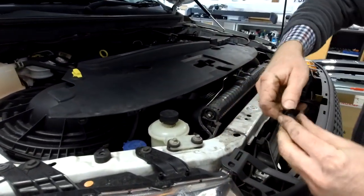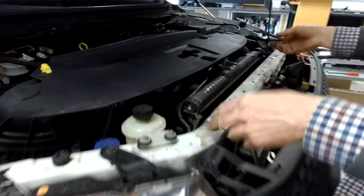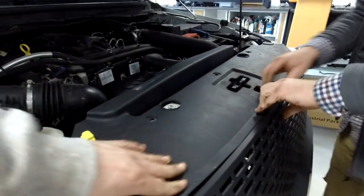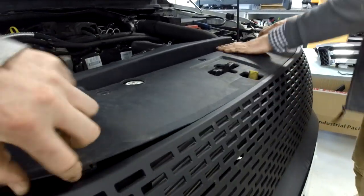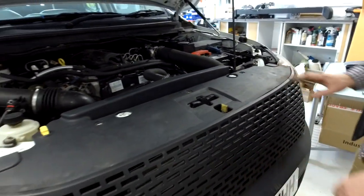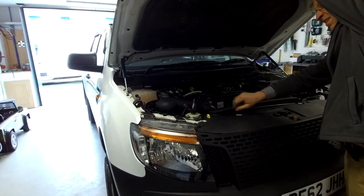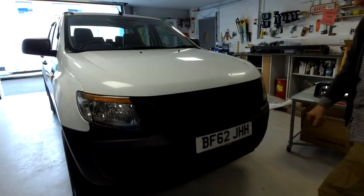Let's close the bonnet - we've just got that top tray to put back on. That top tray should hopefully just click back in. See how these line up. You've got the foot - that actually goes back not too bad. Then you've got those clips to put in - that's just the same as we've just done. Push the outer bit in first and then push the centre.